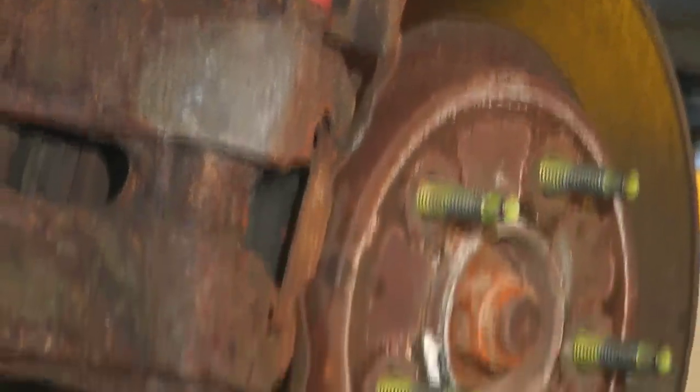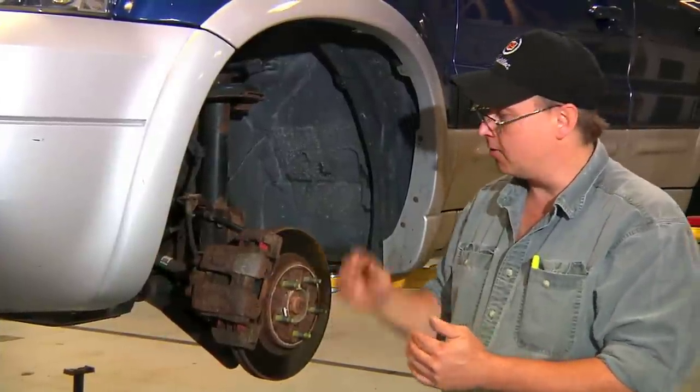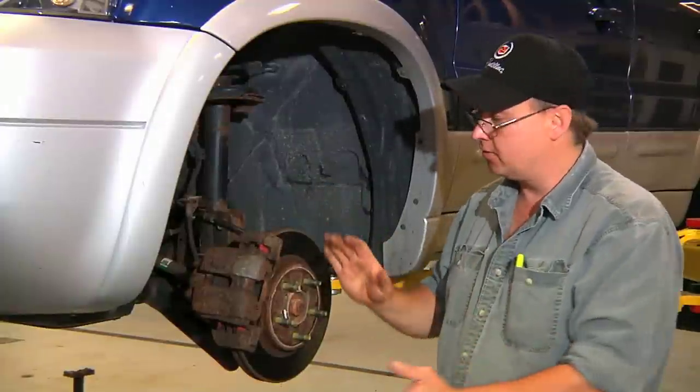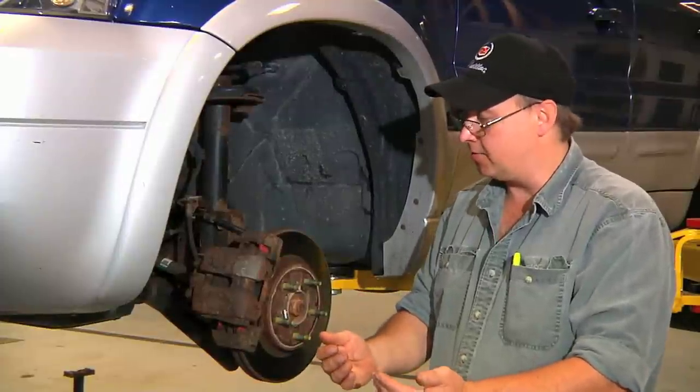Another diagnostic tip, and the most common, is when you have early ABS activation. From zero to five miles an hour, the speed sensor doesn't detect that the wheel is still spinning, so it's an error that the computer reads this signal, thinks your wheel is locked up, and the ABS system is activated. It's a sinking feeling, as your car will want to continue to go even though you're applying your brakes pretty hard.